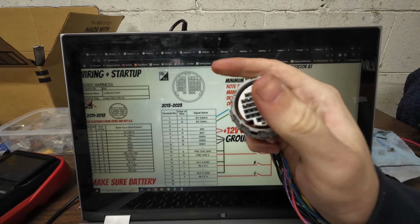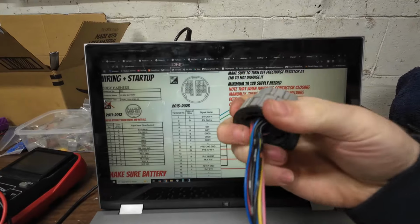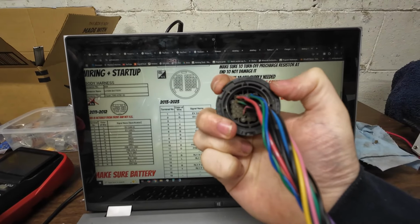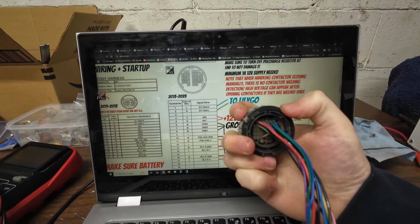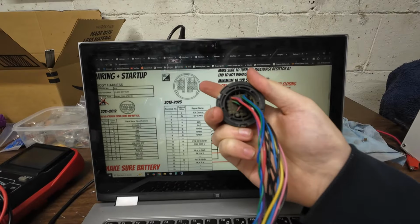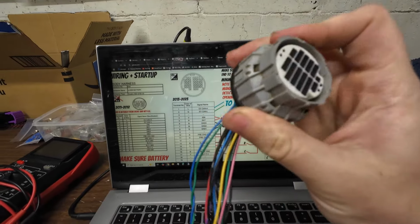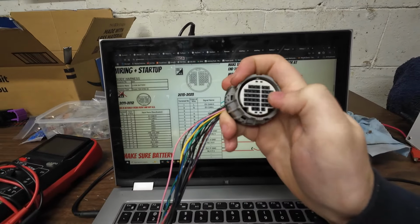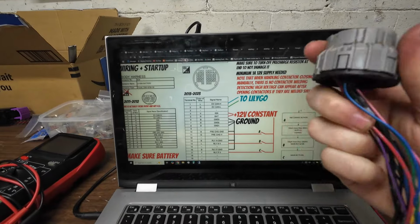Now you might think, oh, that's correct, it's just that one line is incorrect, but he's reading it as if you're placing it like this, which is, this is actually pin 5 in the top right, which it says is pin 1. If you read it like this, now it's correct. Even though his numbers are wrong, the pattern is correct as if you're looking from the outside of the connector, even though the OEM numbers are actually the other direction than this says. Just a note in case you go and try to do this yourself.